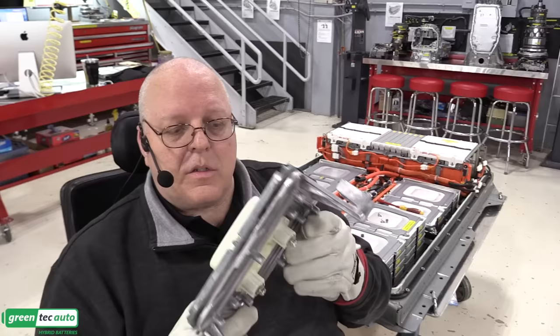And when this lever is removed, it creates an open circuit, just like it is right now, inside of the battery, which reduces the overall voltage of the sections. Instead of it being 360 volts at the contactors, it would be zero, but it really divides it into, let's see, a 270 volt section and a 90 volt section is what it would divide it into.